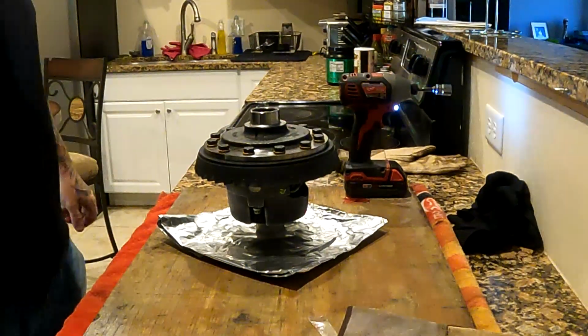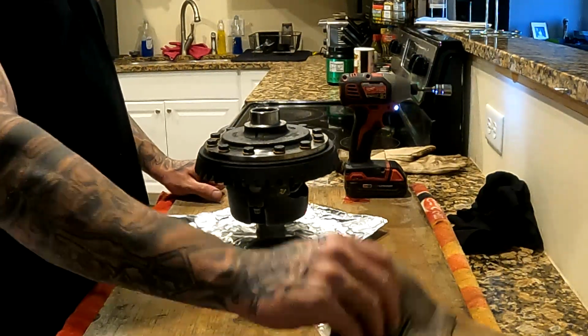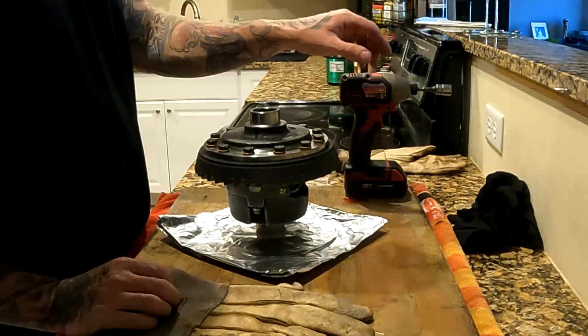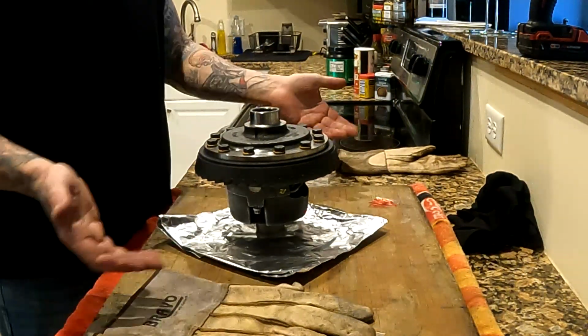They're all crushed down nice and even. Now I'll have somebody hold it and we'll get a torque wrench on it and click it in one place to 55. Ring gear bolts are 55. The cap bolts on the housing are 85. Again, just always double check that kind of stuff, but that gets the ring gear on there.